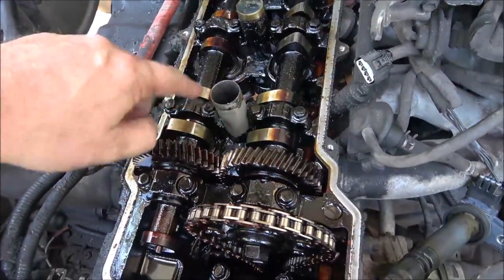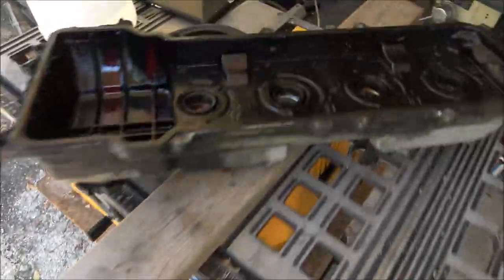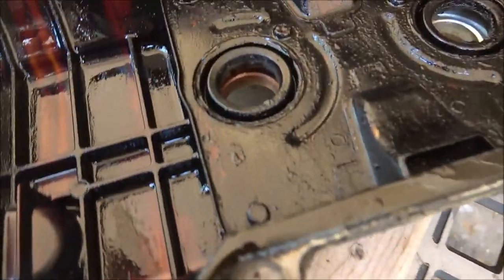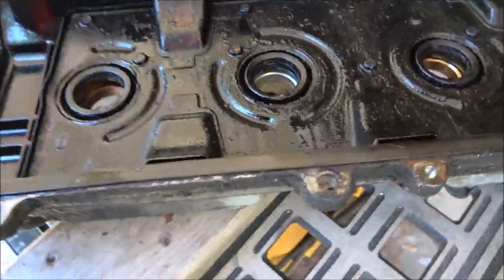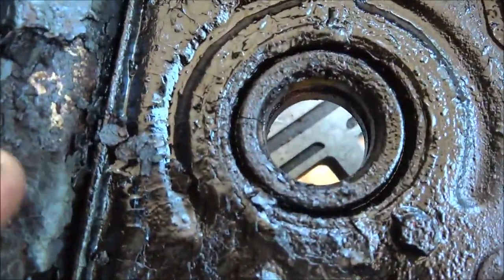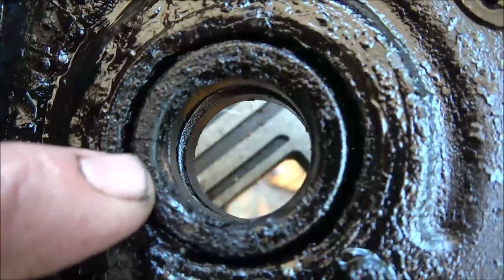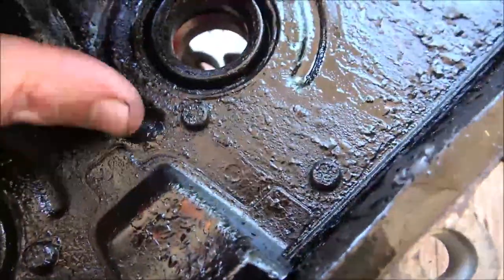There's a rubber seal that goes around them that are in the valve cover, and I'll show you that. Got the valve cover up here in the shade. And what these do is they're rubber. See, this is number one. And these slip over top of them tubes, and they seal. Now, if you can look right here, see that? That's got a crack. All right, that's how the oil was getting down into that plug.